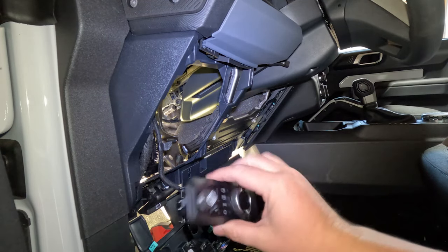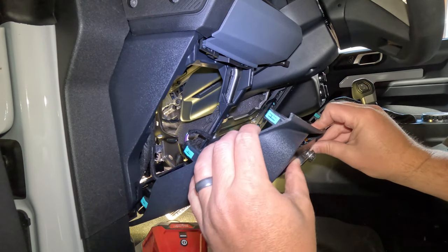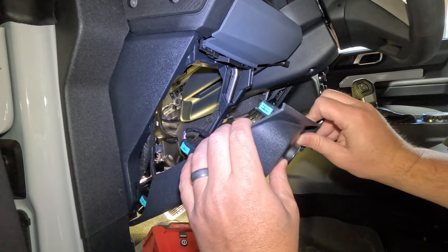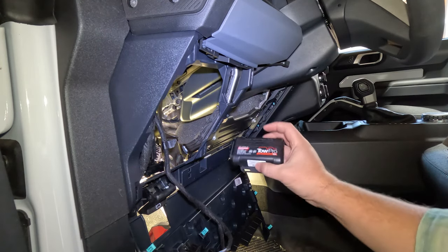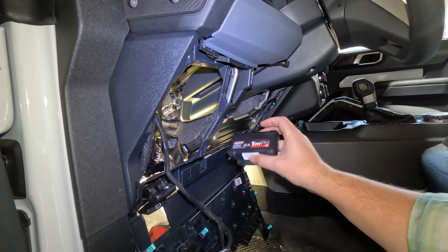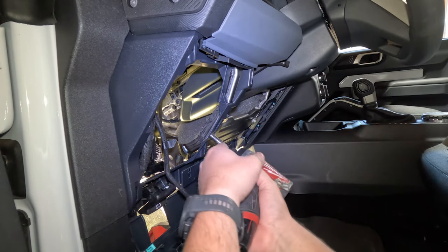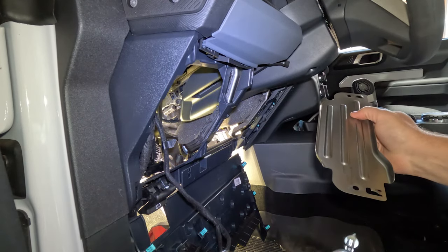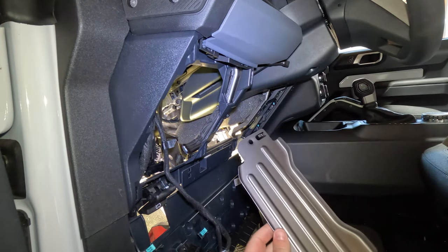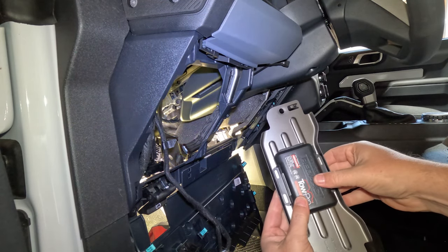All right, so we're going to take our light switch here and put this back into this little swing-down panel — this just presses in here, locks into place. Make sure you plug it back in. We're thinking of mounting our control module on the backside of this little steel plate. So we're going to take this off just to look at it and see the best way of doing that. Just an eight millimeter socket and it takes you about 10 seconds with a little zip gun here. So this is the position it's in back here and we're thinking of mounting it like that — it's almost perfect.